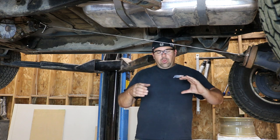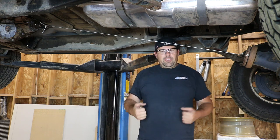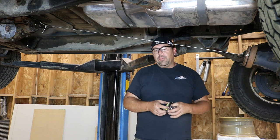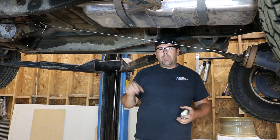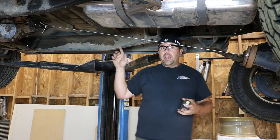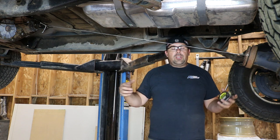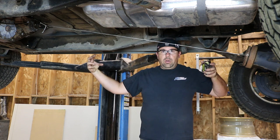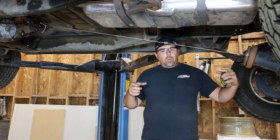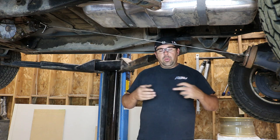I can't tell you how many cars I've jumped in and felt that notchiness and popped the hood and realized somebody put the steering together incorrectly. That can happen on OEM cars too, though most are set up so you can't do that — that's why they use a double-D style shaft. There are a few where they're splined and can be put together wrong. I've also seen it on two-piece drive shafts with a 16-spline slip section clocked wrong, and on one-piece shafts with a slip in them. I've also seen it on front four-wheel-drive systems, most noticeably Ford's TTB systems — people have the U-joints clocked wrong and then get a weird steering vibration in four-wheel drive when there's load on them.